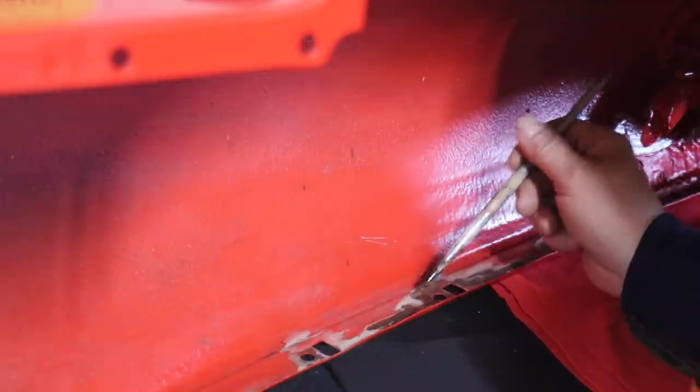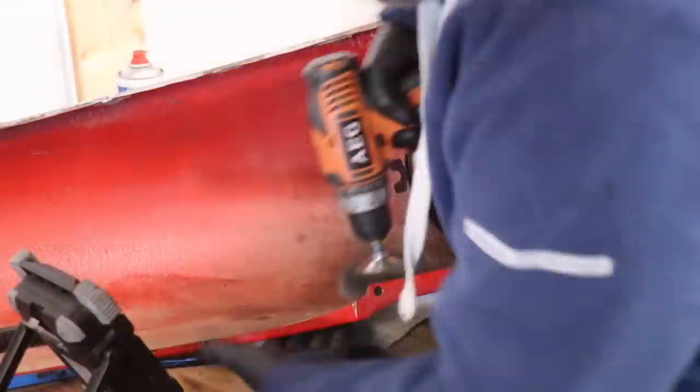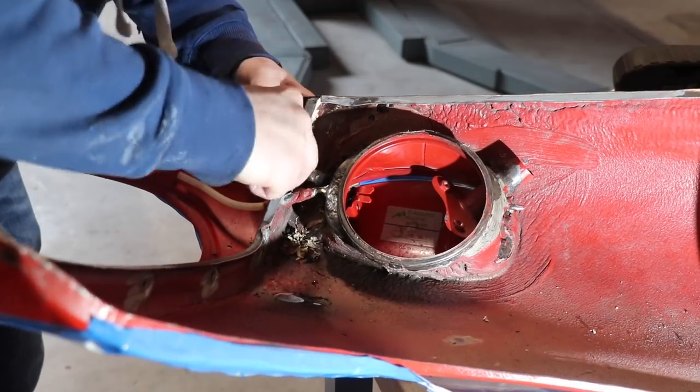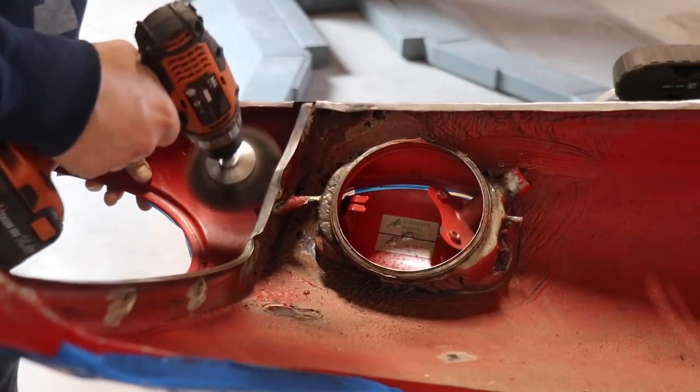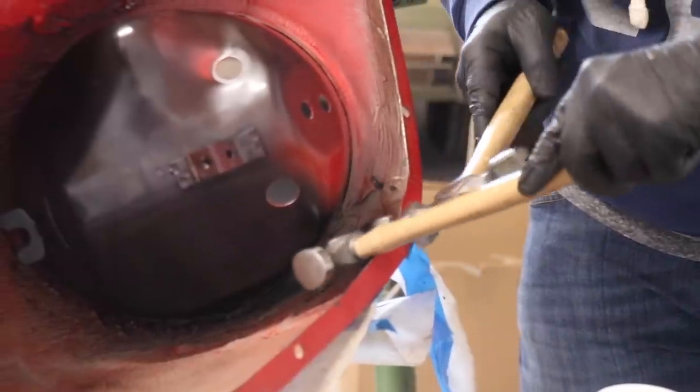What follows is my usual procedure of coating with Brunox, body sealant, stone guard, and two to three layers of paint. I basically believe that all material that survives some heavy wire wheeling, chiseling and hammering is strong enough to stay on the car and keep protecting it.